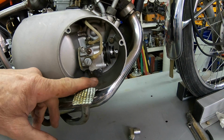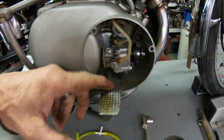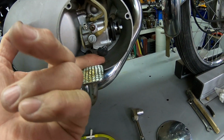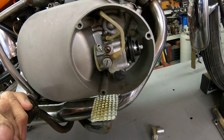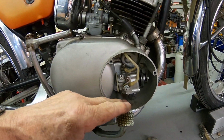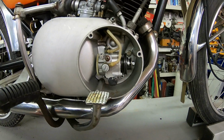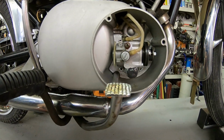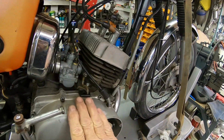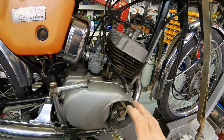I pulled this off and look what I see. That's not Bondo, what the heck is it? JB Weld. It's JB Weld, so I think the casting must be broken, and we're going to run a line and see if this is going to hold. But I've already found an oil pump, so I ordered that. I used one off of eBay, I'm not going to trust that. But that is just another reason for probably the problem. It really sounds like this thing has got main bearings or crankshaft bearings gone in it, and I'm sure that it's lack of oil.